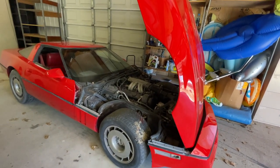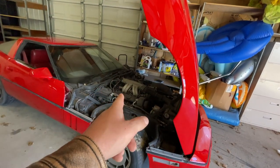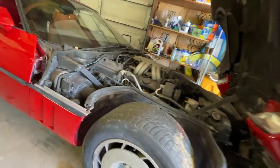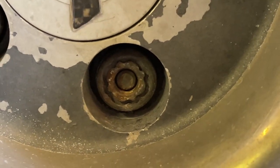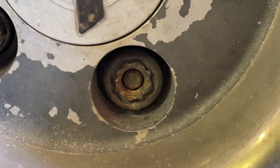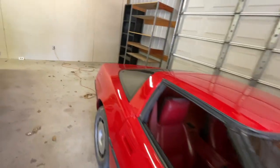We're not going to tear the whole thing apart — I'm going to fix the fuel leak, make sure she runs, and get the tires replaced. That means I've got to get these front tires off with the lock on them, and that's been a bear. I tried throwing a socket over the lock and that didn't work. I also bought a master wheel lock kit from Harbor Freight — that also didn't work. I'll bring you around and show you what happened.